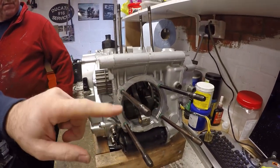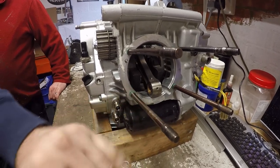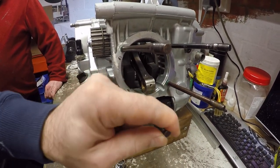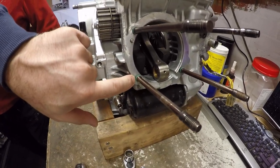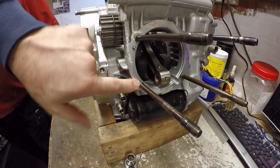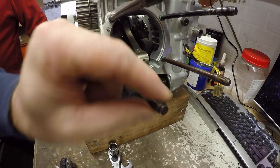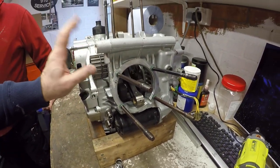Okay, so all eight cylinder and head studs have been placed in. These are tightened down to 25 newton meters, and you just see I used the double lock nut method, and then the O-seal that goes at the bottom to seal the cylinders. You don't have these on the earlier engines, but the key piece is to remember, as you put them over, you want to protect the thread so you don't damage those. Okay, so this is the bottom end completed now.